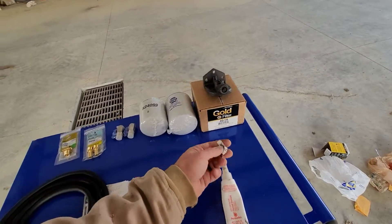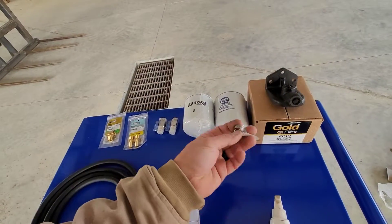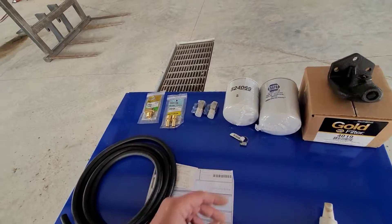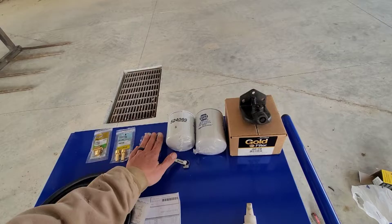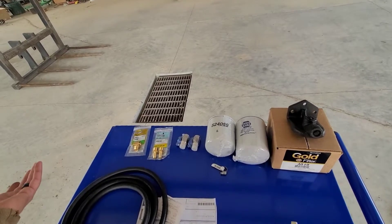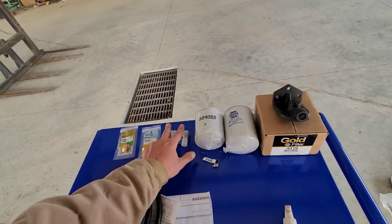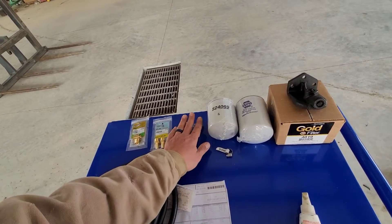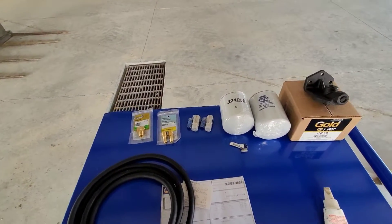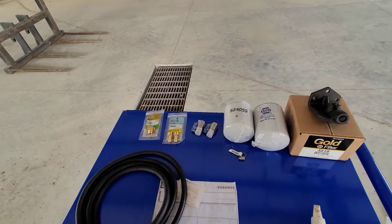You're also going to need a couple of little worm clamps — I got these at Home Depot, the US-made all-stainless steel ones. These attach your actual hose. As for the mini ball valves — do you need to add these? Technically, really no. But on any cooling system filtration setup it's good to have a shutoff, because when you go to change your filter and you can't shut the flow off, you're just going to have coolant dumping out of your engine the whole time. You don't want to be losing a whole bunch of coolant for no reason.